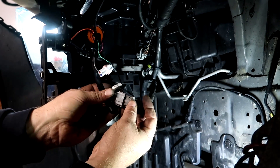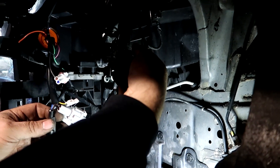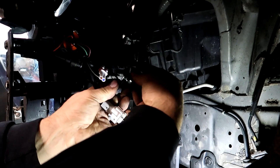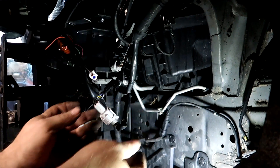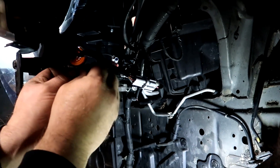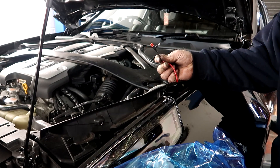You can only go on one way. And then the cross wire I've run across the car — I've brought it through the side of the headlight and it literally plugs into this one here. There's a little lock clip at the top to keep it all together. I'd suggest cable tying that back up. So the next bit — you're going to have to run a wire to the fuse box, so you need to remove all this trim.